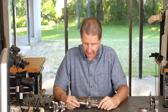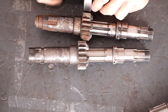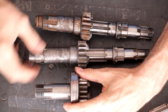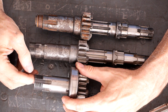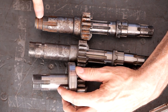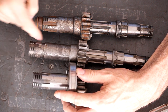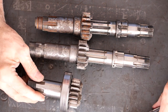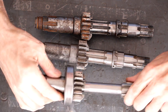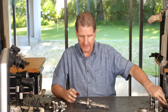Then in '70, with the wet clutch, it's closer to this one. This one still has the bearing. It doesn't have a seal like the older one, and it doesn't have this extension with the O-ring cut. So this is a later model. The shaft is solid now because the clutch actuates from this side. That's a good introduction to the main shaft.